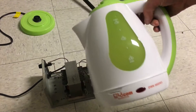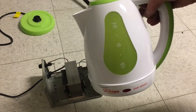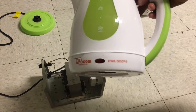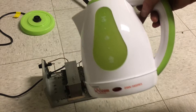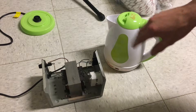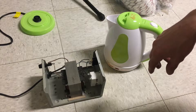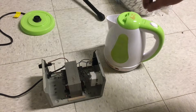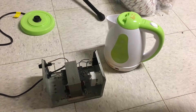I didn't find how many amps this thing draws; however, I know Ohm's Law by heart, so I just divided the 1,500 rated watts by 220 volts — gives me about 6.8 amps. It never occurred to me to check the stupid transformer. Sure enough, I come over and the water's done, and there's smoke just pouring out of the top.